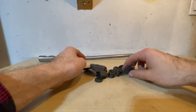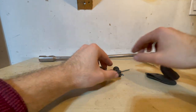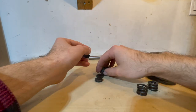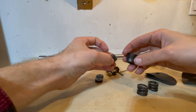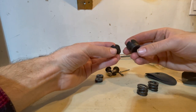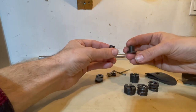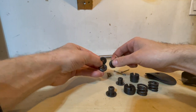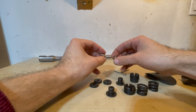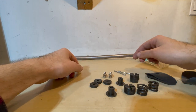There are quite a few components in here. There are the dust shields that will go on to the ball joints, the two springs, and the nuts that will put pressure on to the ball joints. Two of them are a bit different and I'll show you which one goes where. There are also the supports that hold the springs in place, the spacers, new zerks for the drag link, and cotter pins to hold it all together.